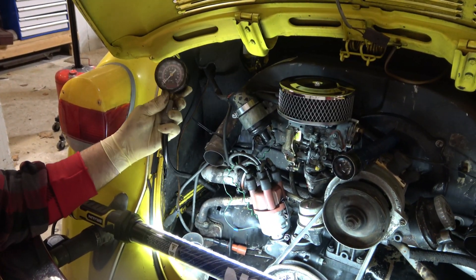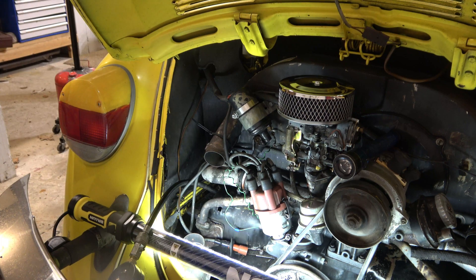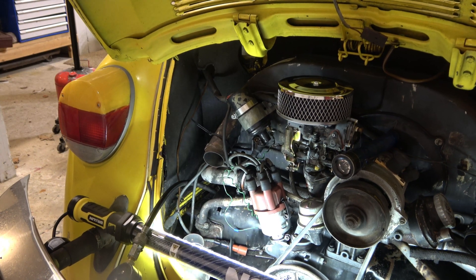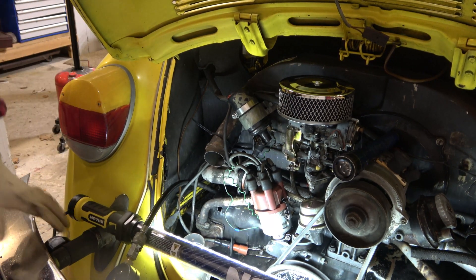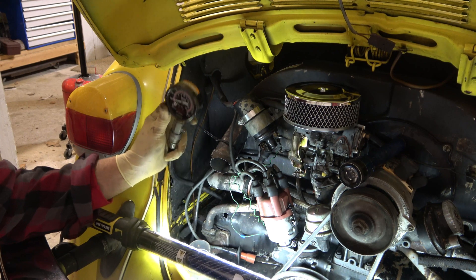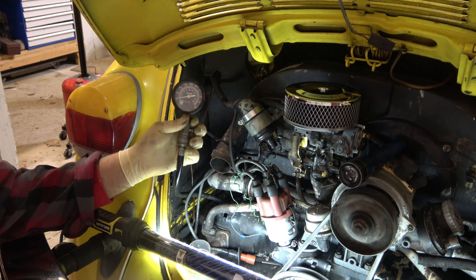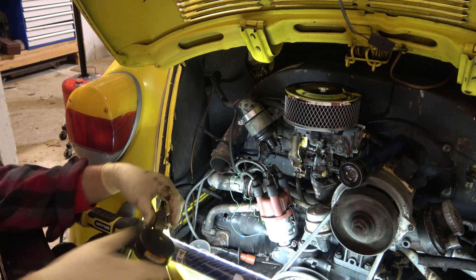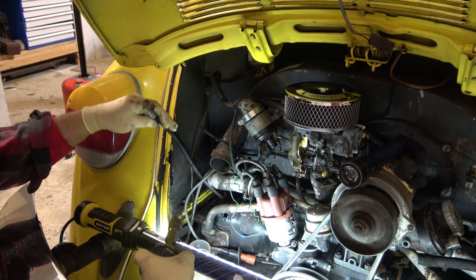So it's on zero. I'm going to go ahead and crank over the engine, and we'll check what it is. The engine should spin over very freely. Eight or nine spins usually does the trick. And oh boy — 30 PSI. That's not good. And that's where the bad, more fouled plug was. So that is really not good. We seem to have found our problem already. It looks like number one cylinder is just not a happy cylinder.